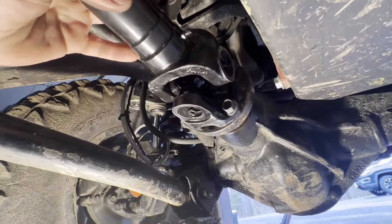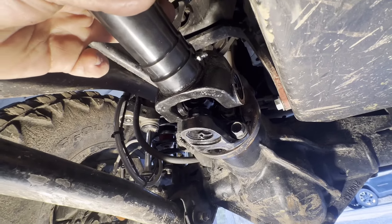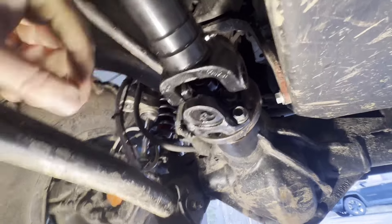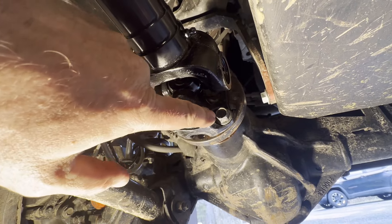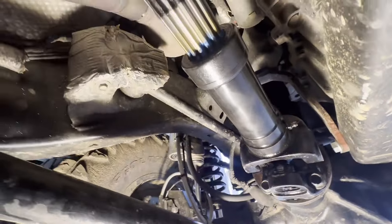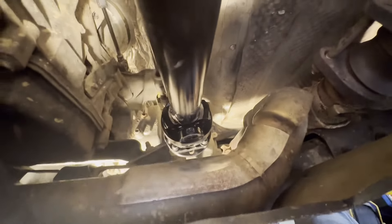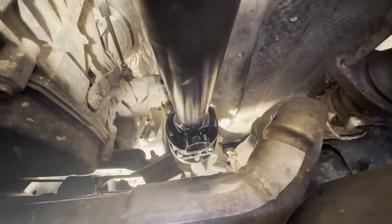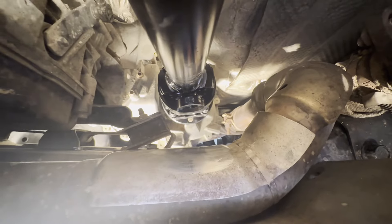Front Adams 1350 OEM flange style extreme duty drive shaft installed. Stock bolts right into the yoke, 80 foot-pounds — they are 15-millimeter head bolts. One interesting thing: look at all the extra space now. If you look at that shield right there, see how that's all been worn? That's where the rubber boot at full droop would hit. So now we've gained a lot of room right there — that's another great improvement.